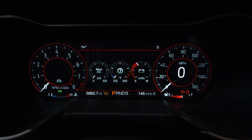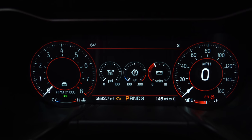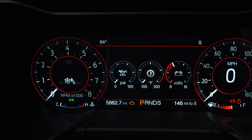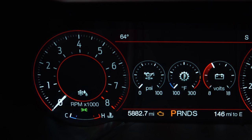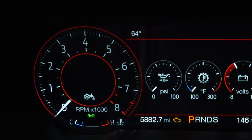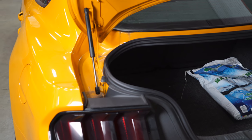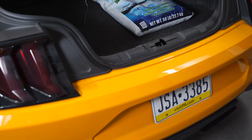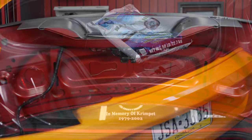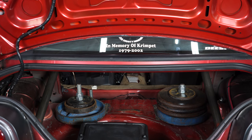While we're on the topic of traction, if you have a newer Mustang, they have traction control built in — obviously leave it on all the time in the wintertime. If you have one of the brand-new Mustangs with the mode selectors, there is actually a snow and wet mode. This is not magical traction in the snow; what it does is make the throttle very unsensitive, so when you give it gas, it's not going to shock the tires too badly. The best way to get traction is to add weight — a couple bags of sand or salt. Two 50-pound bags will give you decent traction, and if you get stuck, both salt and sand can be used for traction. Stay away from barbell plates unless you have a proper way to secure them, as they can be very dangerous in the trunk.